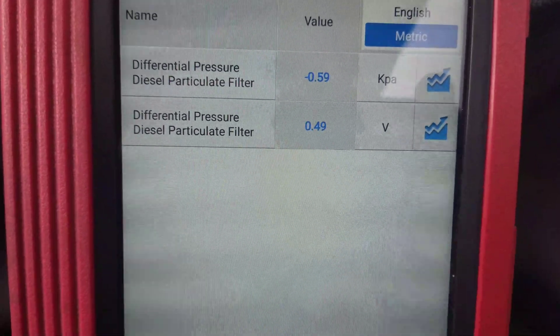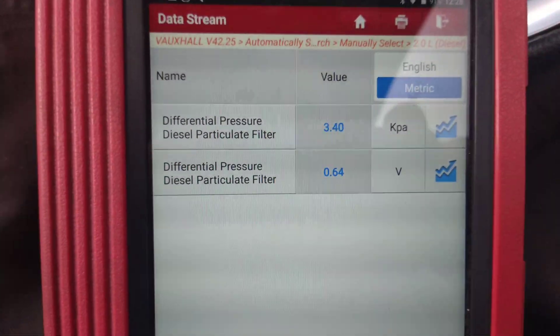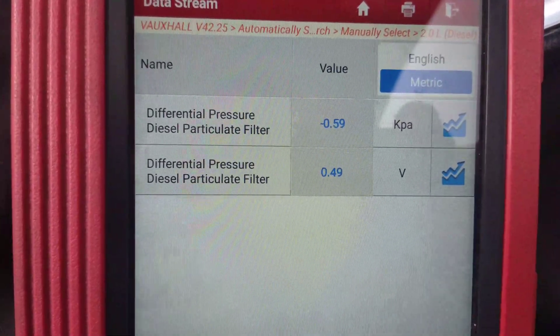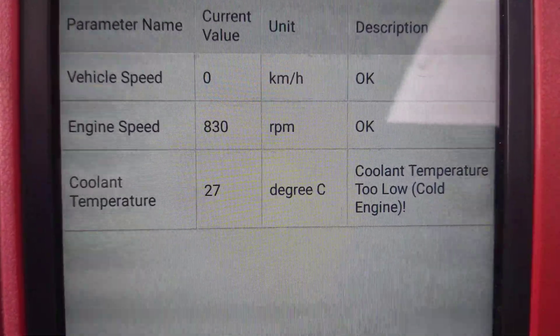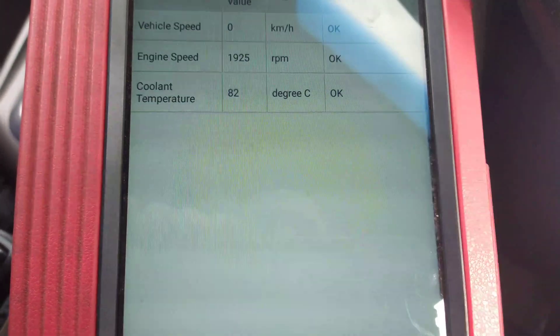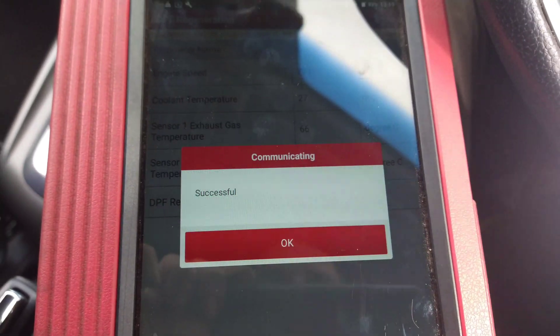The main thing is I've been able to clear the fault code and put the engine light out. This sensor is working fine — you can see that on the scan tool now. I'm going to do a DPF regeneration just so I know it's capable of doing that before the car goes away. I'll have to warm the engine up first. The engine's going to rev up quite high whilst this is going on, but that's normal — it'll slow down when it's finished.